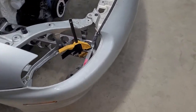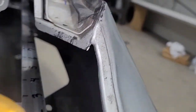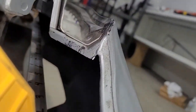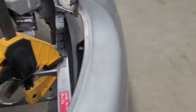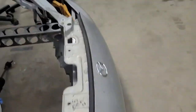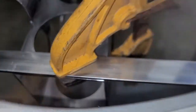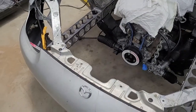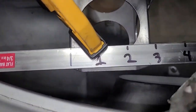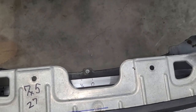I want to show you guys something. I need to pick up the inside curve of this bumper skin — how do I do this? So here's what I did: I took a flat piece of metal and just laid it on here. I lined the front edge with my box tube and clamped it in position. Then I drew a scale in one-inch increments halfway across — I'm assuming it's symmetric, and I checked it and it's really close because everything's pretty square.